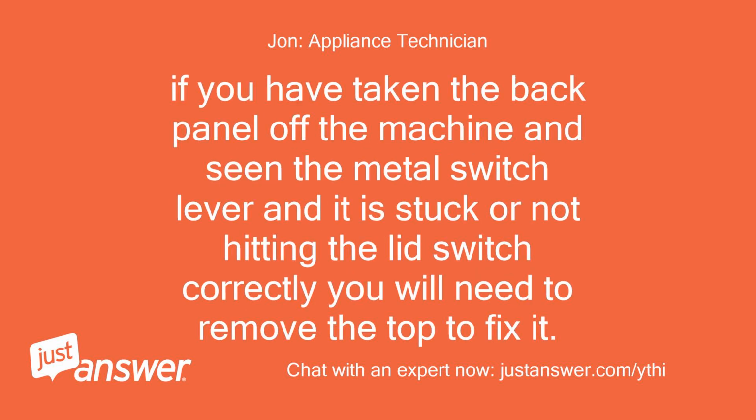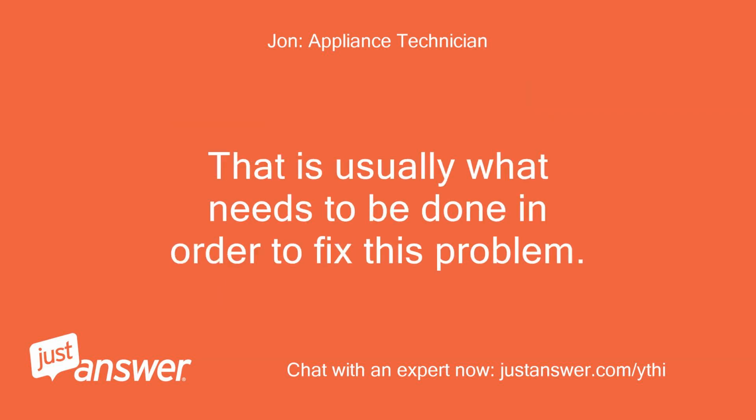If you have taken the back panel off the machine and seen the metal switch lever and it is stuck or not hitting the lid switch correctly, you will need to remove the top to fix it. That is usually what needs to be done in order to fix this problem.